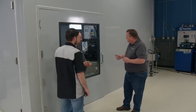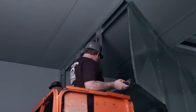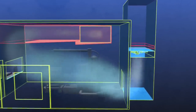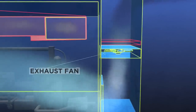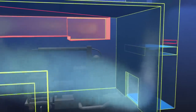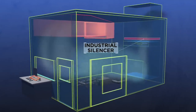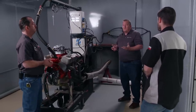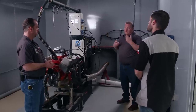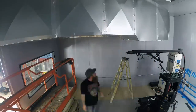The inlet duct brings in fresh outside air, which flows across the top of the engine to keep it cool during testing. The test cell has a plenum with a powerful fan that draws in fresh air and evacuates heat and exhaust gas through an enclosed exhaust stack. Thanks to an exhaust fan which moves 30,000 cubic feet per minute, the system exchanges all of the air in the room 10 times a minute or more. Beyond the exhaust fan is an industrial silencer which reduces the sound level transmitted to the outside. The test cell also has an air inlet silencer designed for combustion air, which you can draw directly from your shop for a more consistent air flow source. With the test cell all buttoned up, we'll turn our attention to the dynamometer.